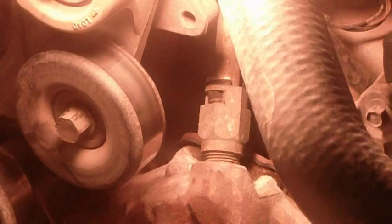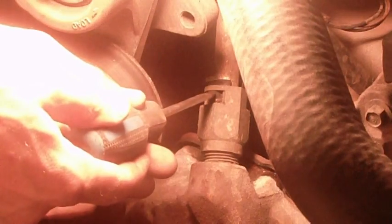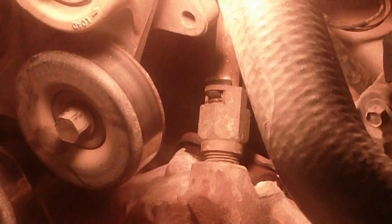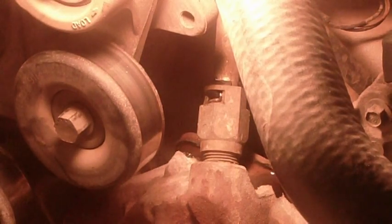Anyways, all right, I think this is the heater core outlet. And it's gonna have these two tabs here. They're kind of rotten on mine, so I'm gonna try to push them in from here. Oh, look, we're leaking right away. I gotta put a drain pan down. Been leaking. The backside worked. Okay, I'm gonna have to take the water pump out and maybe it'll come out. And I got the water pump all loose.